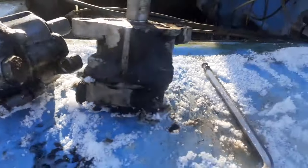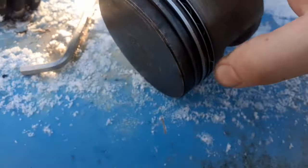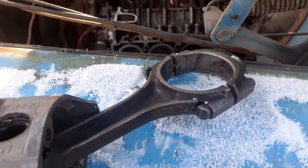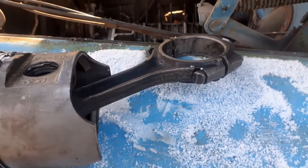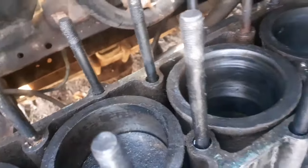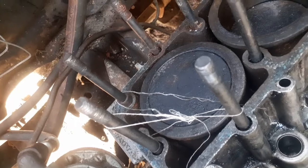I pulled one of the pistons from the problematic cylinder. These witness marks aren't mine — somebody in the past has hammered this piston a lot. The ring is a bit rusty but salvageable. Interestingly, this still has the standard 0.00 tolerance rod bearings, meaning the crankshaft hasn't been ground — it still has factory specifications. Here's the cylinder cleaned up — not too bad. It needs a bit more cleaning. There's one cylinder with a broken ring, but no gouges or scoring in the others.